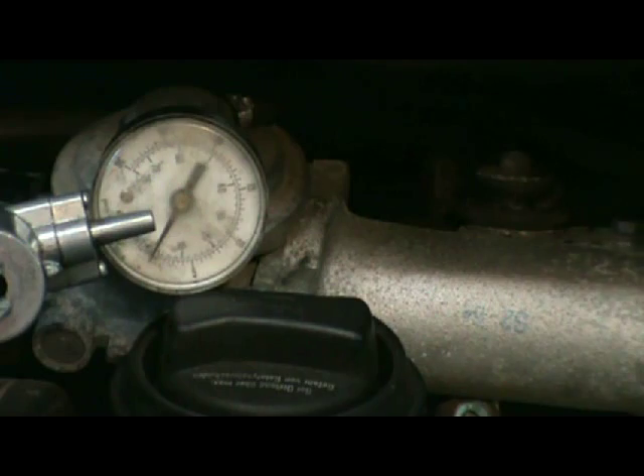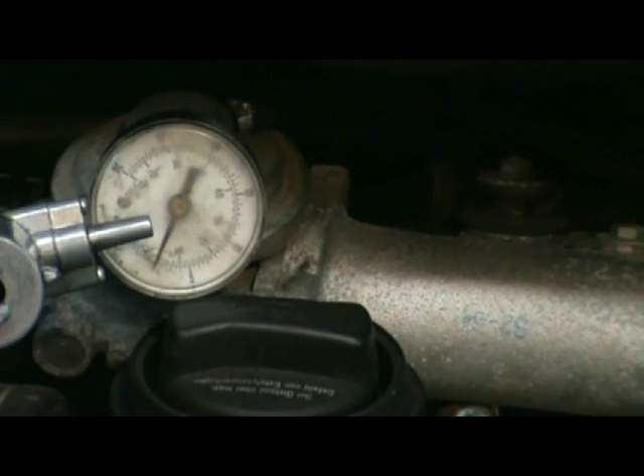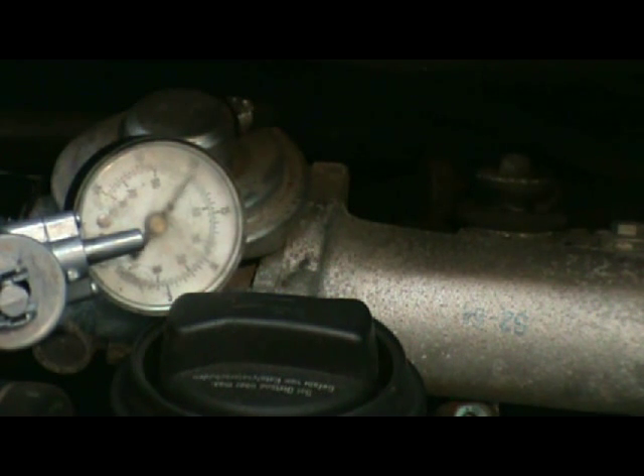This engine is a hot starter, but as you can see, we have vacuum now, so the rest of the system integrity is pretty much there. If we take care of the wastegate and rerun readiness, we're pretty much all set. I'll show you a couple of components that can cause other problems in this system.